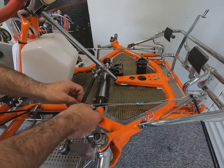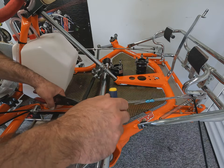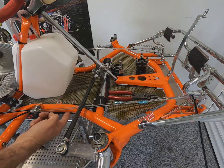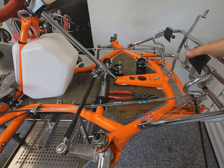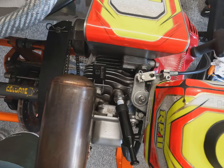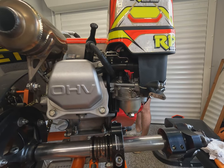We now need to slip the respective cables back down the same ones they came up and slide the locking collar over both cables. Pull the free play out and lock the two cables together. We can see a nice amount of free play so it's not holding the throttles open. Now cable tie the throttle pedal wide open and make sure we're achieving wide open throttle. On the carburettor, the throttle plate is up against its stop in the fully open position — as we release the cable tie you can see it going back, confirming that you are achieving wide open throttle.